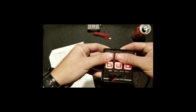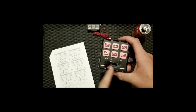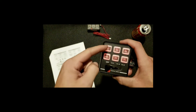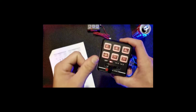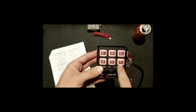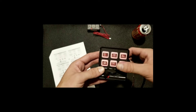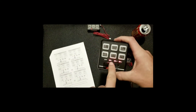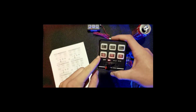Now I want to show how to change flash patterns using the slide switch. It's very similar — instead of pushing buttons to cycle patterns, you're using the slide switch to change patterns. Same entry: press all three bottom buttons at the same time. Then it lights up asking which mode's pattern you want to change — use the slide switch to navigate to the corresponding mode.